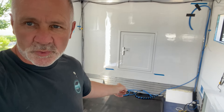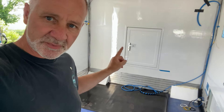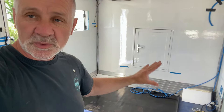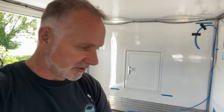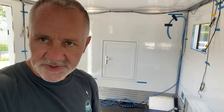We're back at it — tools and boxes and kit everywhere. One of the first jobs is to get the water tank in, because I want the aluminium frame made for it. I've put a bit of rubber matting down so the tank doesn't slide about. It will get strapped down, dressed with all the valves, and then we'll get this aluminium frame made up for the seating area. Drainage is key — the waste tank is almost dead center of the vehicle, which is great from a weight distribution point of view. I've got to get that in before I get the floor in, so the drainage will sit within the subfloor itself.